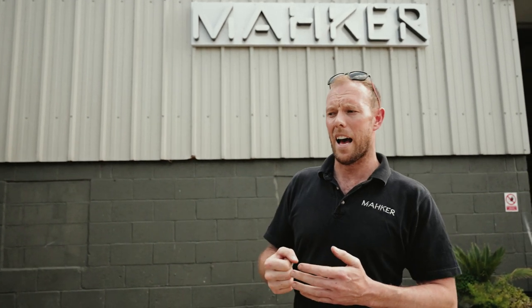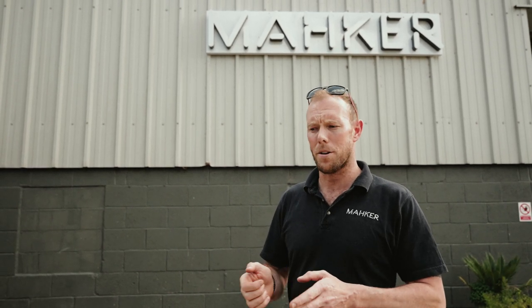So guys, fantastic day at Shropshire Automotive Services. The dirty 130 outperformed what I thought it would do. The torque figures were fantastic. I think we're knocking on the door of about 819 newton meters, which is pretty outstanding for a 3-litre straight six diesel. There were a few people like Luke Dale from DP UK. He was literally flabbergasted by the torque figures, and he was there with his 5-cylinder OM605 and was like, Dave, how did you get that torque figure?